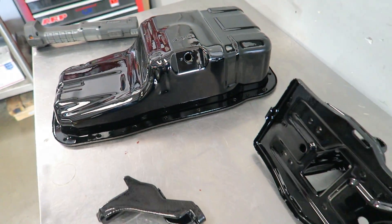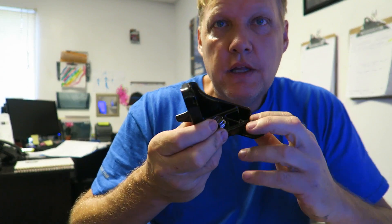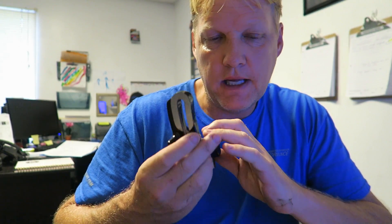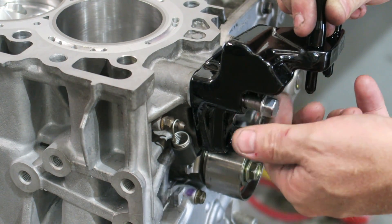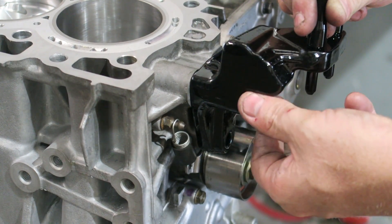A little disclaimer here: this bracket is the top alternator bracket. After I installed it I thought about it and realized the alternator is not going to ground. So I had to shave this area here. The alternator is going to contact here with a bolt, and these two points are going to mount to the block — that's where it gets its ground. If the whole thing is powder coated, the alternator won't get a ground, which means it won't charge. Keep that in mind. As you can see, we cleaned up the bolts here, and this isn't sanded and cleaned in the video but it is now.